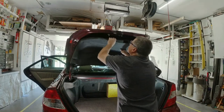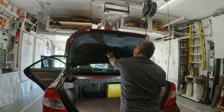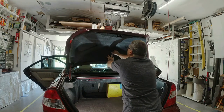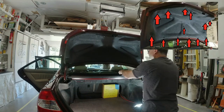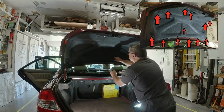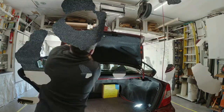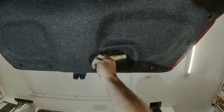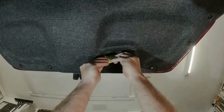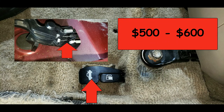It's time to put the last piece on — the inside liner for the trunk lid. Lift it up and put the button in the very center; that will hold it in place. Now it's easy to go around and replace all the missing clips — basically, if there's a hole, put a clip in it. Now let's not forget the emergency handle — just snap it into place. Congratulations! You just saved five to six hundred dollars, less parts. And hopefully you've got a big bucket of extra clips for your next repair job. Thanks for watching!